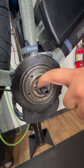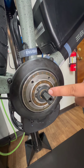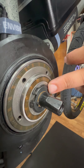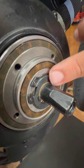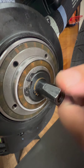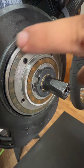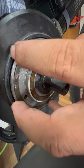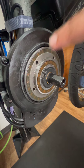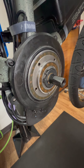There is a C-clip here which you have to remove using a spanner tool, and underneath it you can see those two copper washers. Those actually came with my kit, and I installed those underneath this spindle to tighten it up. Also underneath this bearing assembly, you can actually just pull this out if you remove this clip, and you can install a spacer behind it, which I've also done — and I'll show you guys what that spacer looks like.